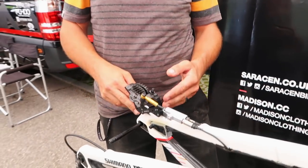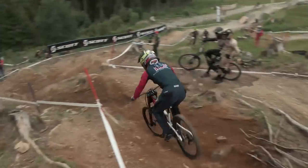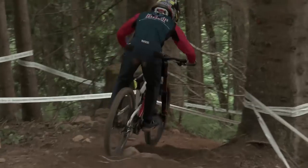Inside here is also a vertical sensor that does the same as the fork. So we get to know if the bike is doing this. Essentially we want it to do this, because the pilot doesn't move anymore in these bikes — they're so long and the cockpit doesn't make you have to shift weight anymore. So it's really critical that the suspension does an extremely balanced job. We measure front and rear axle movement in several measurements: G meters per second, or just pure millimeters. Anyone can tell if a fork is doing 150mm and the rear is doing 200mm when it takes a big bump force, then you've got an imbalance — the chassis is sort of seesawing up and down as a result.